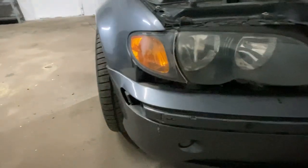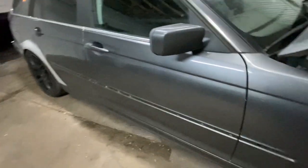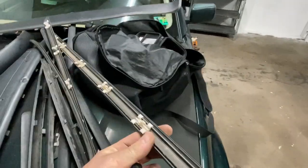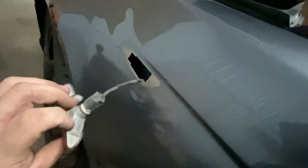Since this isn't the first E46 I've done, there are a couple of things I've learned. There's a little filler panel underneath the headlight — take those off so you can get in there nice and deep and then paint those small panels separately. When the trim is off, the moldings have plastic clips and on a 20-some year old car you will break them — that's just part of it. All of the rubber moldings just pull off; you have to get in behind them. The side markers actually slide forward and then you can get underneath and pull them out. I'm still going to pull door handles and mirrors.